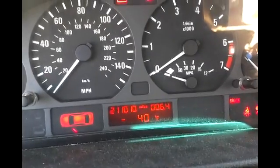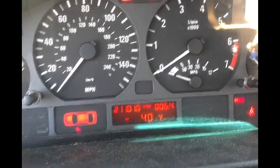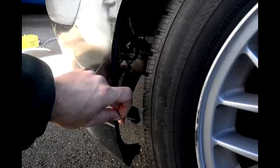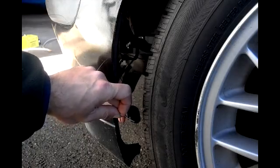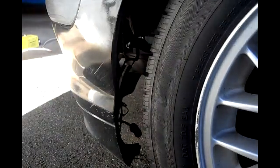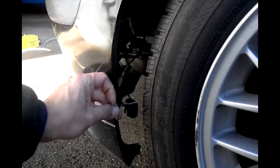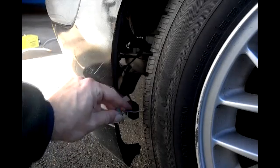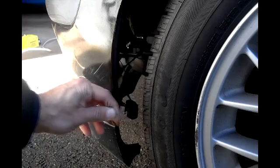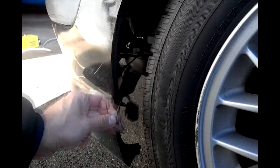You can see it reads negative 40. That usually means the sensor is open, so it's probably missing. In my left fender well, I'm missing the plastic panel that goes under here and attaches to the wheel liner — that's where the sensor should be. And these are my two wires from my outside temp sensor. At some point this has been damaged and pulled off when something happened that destroyed that panel.